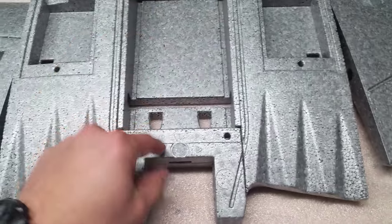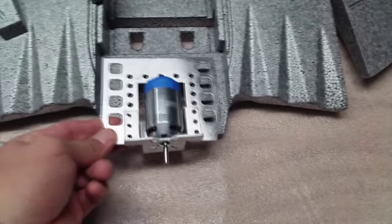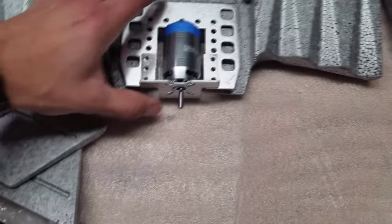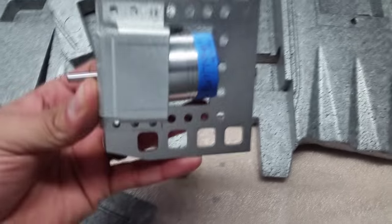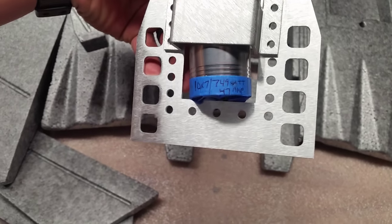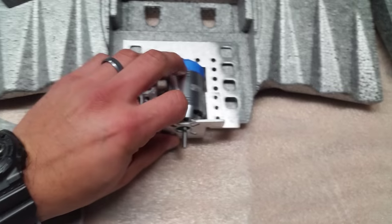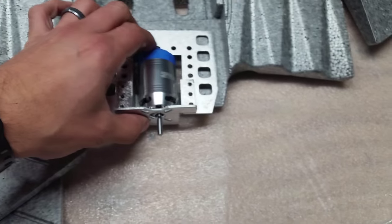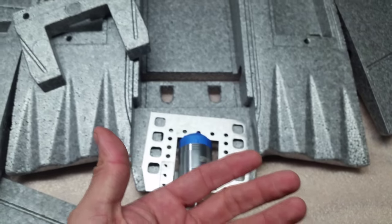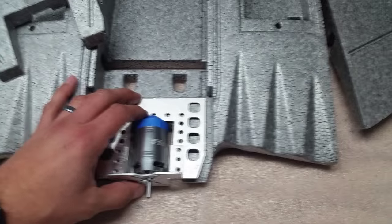The back portion here is for the motor. One of the motors I was playing around with does really well — on 4S with a 10.7 prop it does 47 amps and just under 750 watts, plus or minus depending on your battery's C rating. It was still really cool running. I probably won't use that one — I ordered another one that puts out a lot more watts but I don't want to go faster.